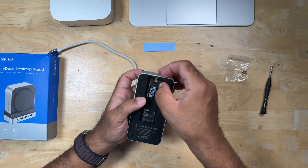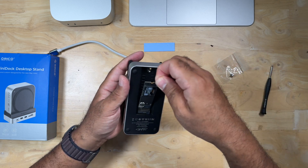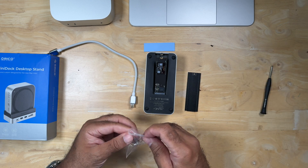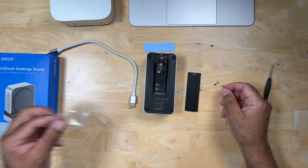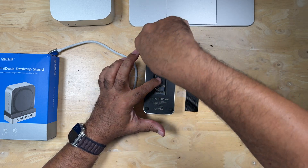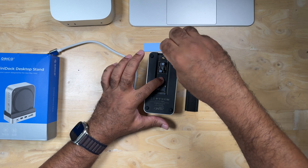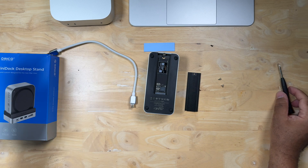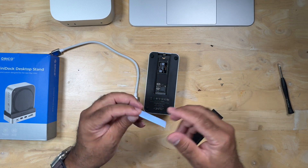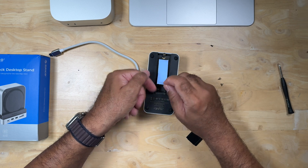Slide it in and make sure you have it connected the right way. It comes with the tiny screw you need to lock it in. It looks like it only supports full size, although many smaller M.2 drives come with an accessory tray if you want to use a shorter drive — I'll double check and put it in the description. Pop this in, give it a little press down, tighten it in — that's it, snug as a bug. Don't over-tighten; it's an SSD so you don't need to go crazy. Then apply the heat sink tape directly on top of the chip.